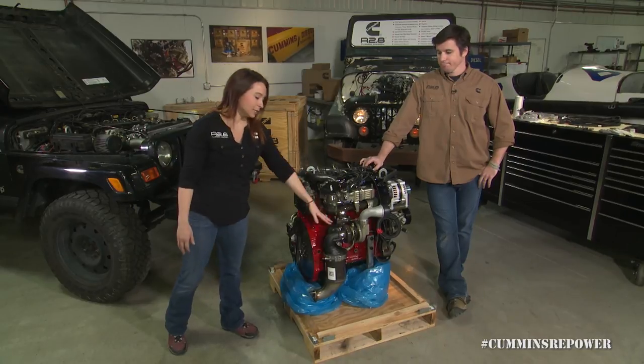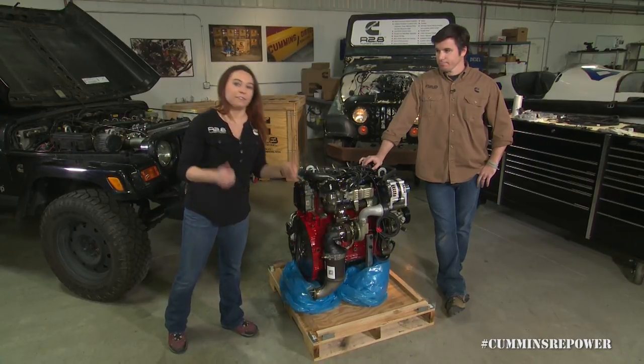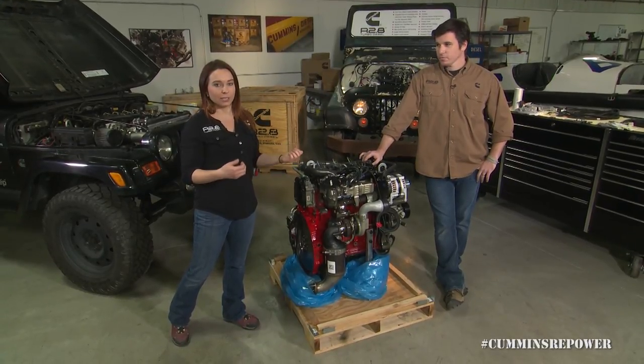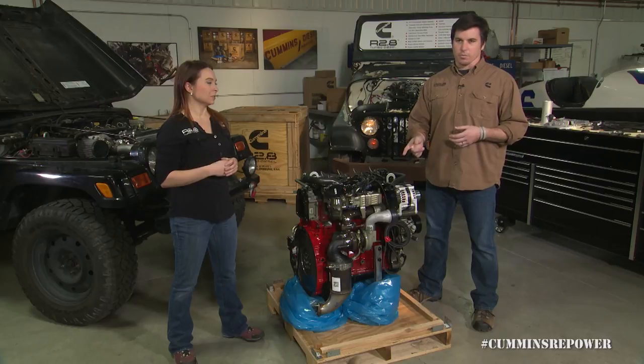No reason to take it off. It acts as your downpipe, so there's all the benefit to you and none of the downsides of the normal after-treatment you're used to seeing on 2017 engines. One thing about the DOC — a lot of people look at this engine and think that's the first thing they're going to take off, thinking it's a performance benefit. It's not. From the test vehicles we've had with and without them, it's definitely a benefit if you park in the garage or do a lot of cold starts. Even on a modern gas vehicle, when that catalyst is cold it can let out a nasty smell in your garage. This really helps clean that up, so I wouldn't recommend taking it off.